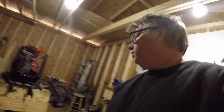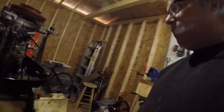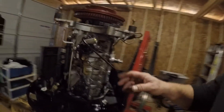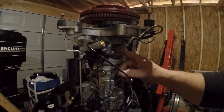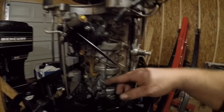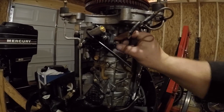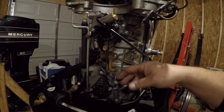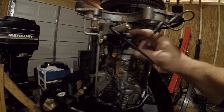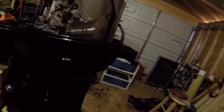We're getting along pretty well. I did put my carbs on — there's a gasket that goes behind there and then it's just four bolts. I didn't show that but it's really simple. You just got to slightly put it on and then get your bolt in there. It's a pretty chilly morning but we're in pretty good shape.